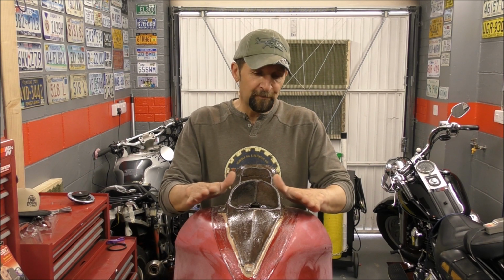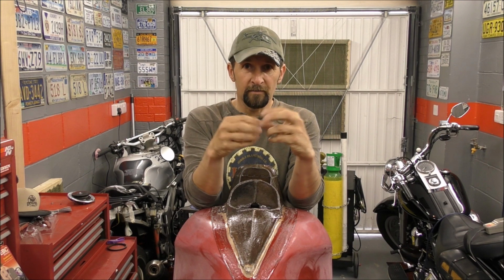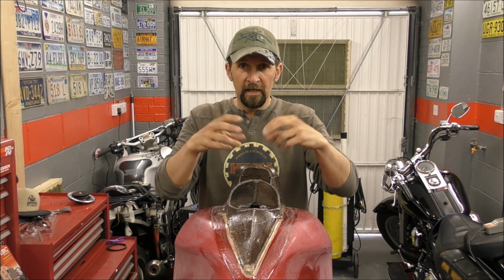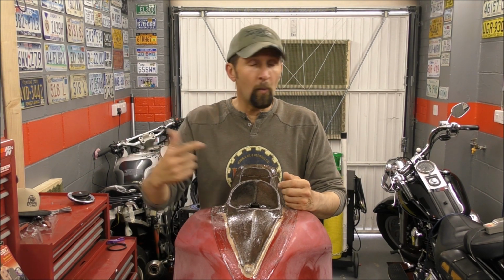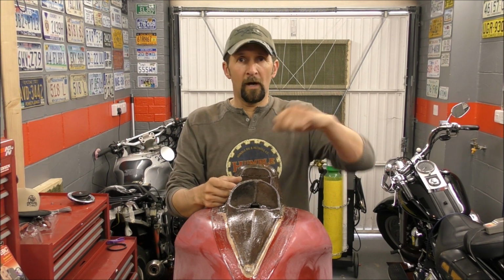So what I'm going to do, I'm going to bridge it. You can buy a thing called bridging filler, and what it is is fiberglass matting that's been shredded to its fibres. It's just a pile of literally the loose fibres, like fluff, and they mix that with a resin, or one part of the resin. You buy that as a filling stopper, and then you put the hardener in, mix it together, and you end up with a big gummy mess. But it's still quite heavy, and there's no need for it. I'm going to do something else.